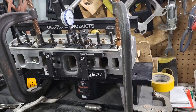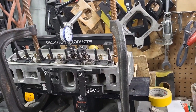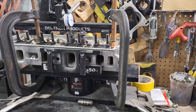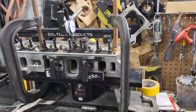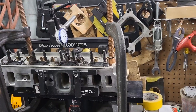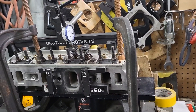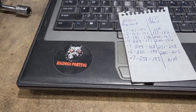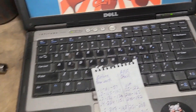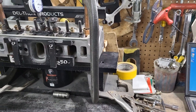You guys are stuck on name brands — you've got to have this name brand or that name brand. Pretty much all cylinder heads now come out machined with the latest equipment. We check everything to make sure you're starting off with a good base. Personally, I just can't see spending $2,100 on a set of cylinder heads that at 600 thousandths flow 260 CFM, and then you have to spend more money to get them flowing up to par.